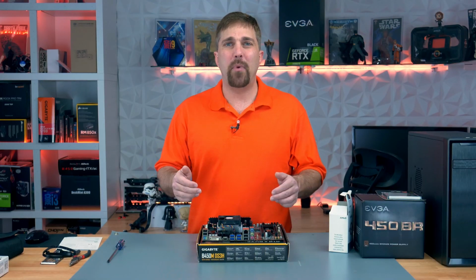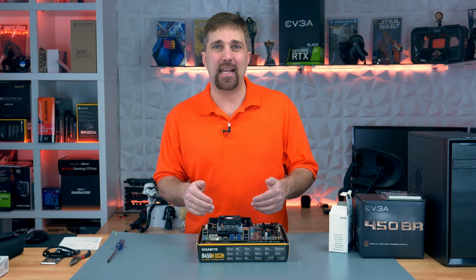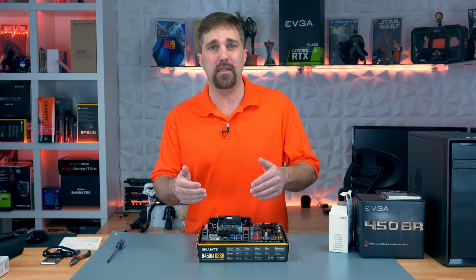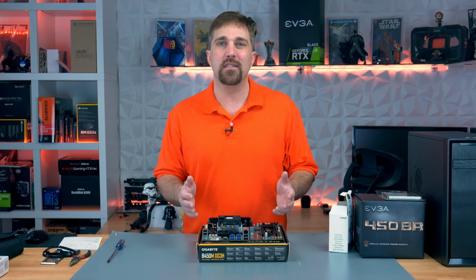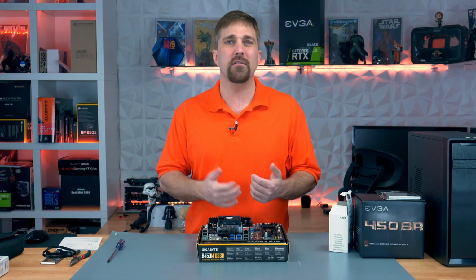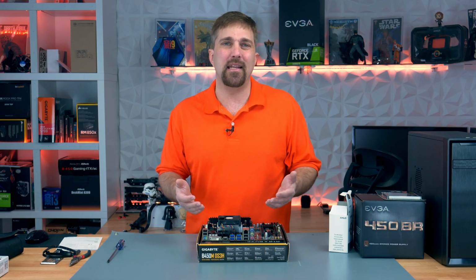Now the disclaimer. By using only one memory module, the system can only operate in single channel mode, channel A in this case, which will affect performance as it introduces a delay in communication between the CPU and memory. However, for most common workloads of a desktop PC, this isn't anything you'll really notice. Now, if you're working on large spreadsheets or databases with multiple sheets of pivot tables or querying data from multiple sources across the network, then you'll want to upgrade your memory to a second 8GB stick for 16GB total.